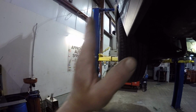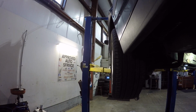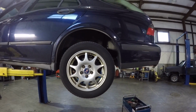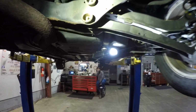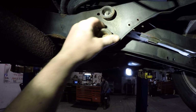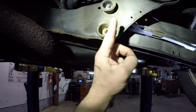But unfortunately, when you lift a car or change suspension heights, and I don't know if this translates well, we have a bit of a negative camber there, or is that positive? Negative camber there, where the top's coming out a bit. So I need to correct that, because when the car is lifted, it's going to be sitting statically about where it is now. So I was thinking of, some car makers use a slot with an oblong washer and 2 pins or 2 studs to hold the washer, and then when you spin it, it will move the arms forward and backwards.